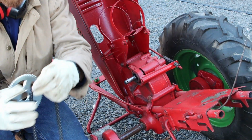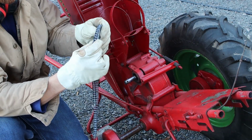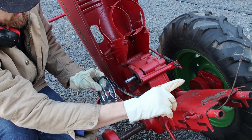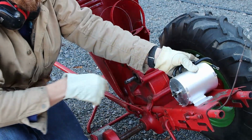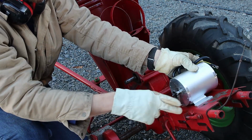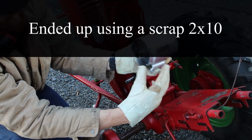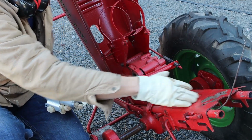And this is a bicycle chain. And that bicycle chain is going to connect to our electric motor here. So our electric motor is going to sit where the old Briggs & Stratton was. And obviously our holes don't line up there. We will take the electric motor, since this is still a prototype, and drop it right onto a 2x6 piece of lumber, and connect that 2x6 via those 4 holes, bolt it onto here.